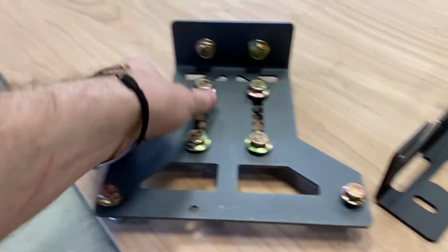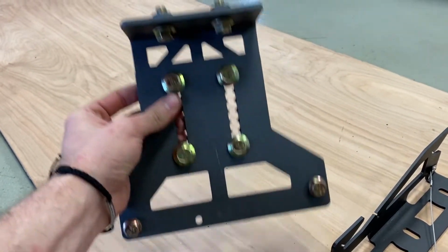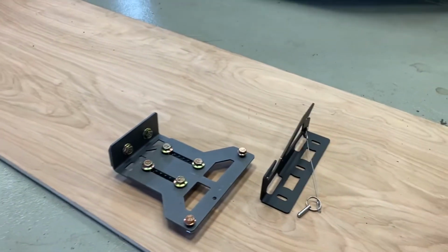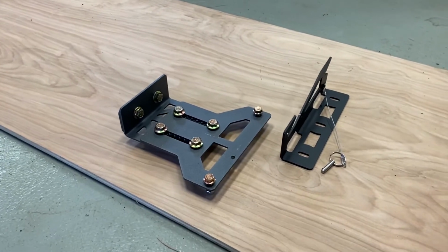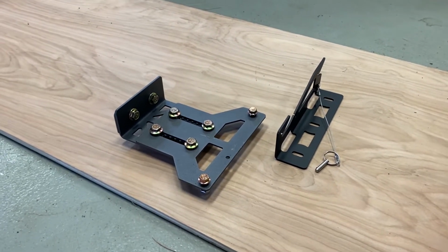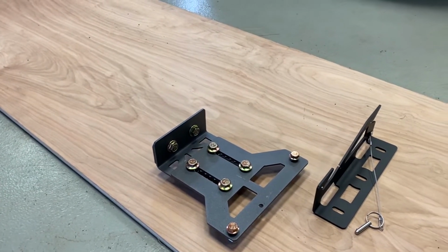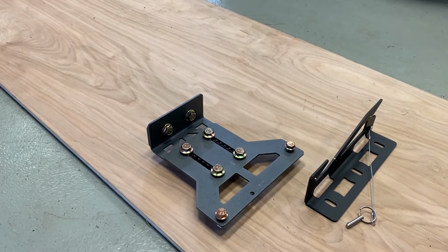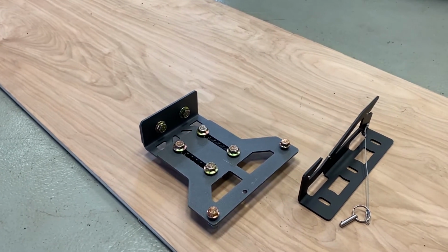And the nice thing is, the angle, the setting, the height, it's already set, it's fixed on the car, so you don't have to. What I used to have to do is, I had some basic splitter brackets, and I would have to set the pitch, set the height and everything every time I took the splitter off. And trying to get on and off the race trailer with the splitter sometimes was difficult, sometimes impossible.